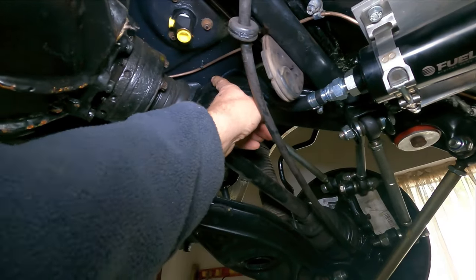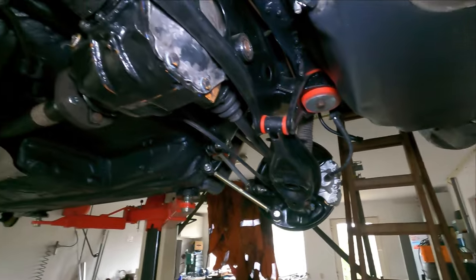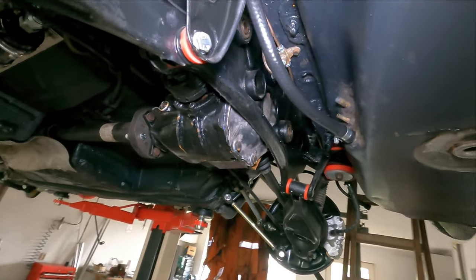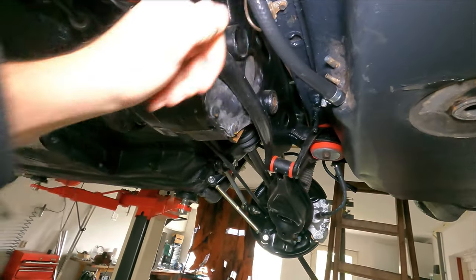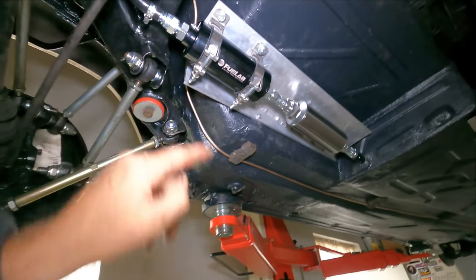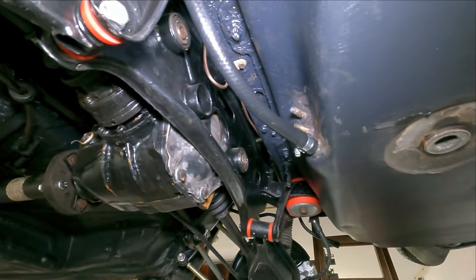The feed line is going over the subframe. I am going to support this later on with a tie wrap or something else so it will not move around. I will do it when I have the rest of the lines at the right location. This is connected - it is like a 12 millimeter fuel line, a little bit bigger than the inlet of the pipe which is about 9 or 10 millimeters. The outlet of the tank is even bigger at around 13 millimeters, so it fits pretty good.